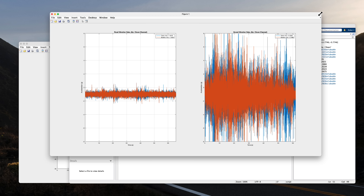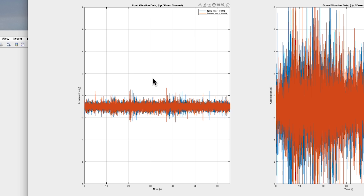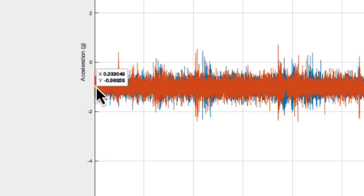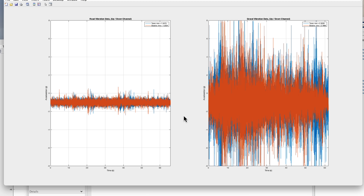The following plot shows the data in the time domain — a plot of raw data measuring acceleration in g's versus time in seconds. On the left we have the road data with the Butano in red and the Roval Terra in blue. On the right is the dirt descent data, again with the Butano in red and the carbon Terra in blue. In all cases the data is centered about negative one on the y-axis, which is a sanity check since we live in a gravitational environment where acceleration due to gravity is negative 1g. A lower accelerometer measurement corresponds to a smoother ride, which is why both road datasets are so much lower in amplitude than the rowdier dirt data. However, beyond visual inspection there's actually very little you can discern about vibration damping properties by looking at data in the time domain.